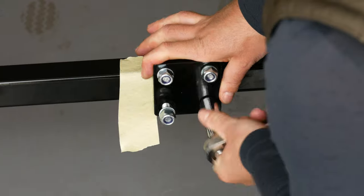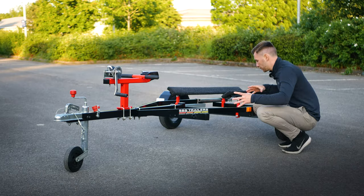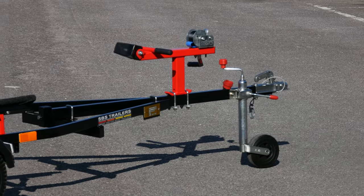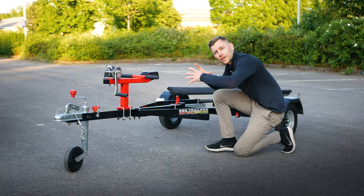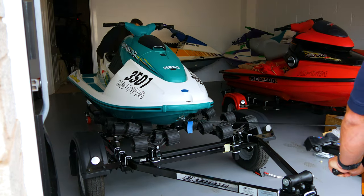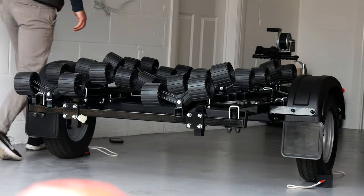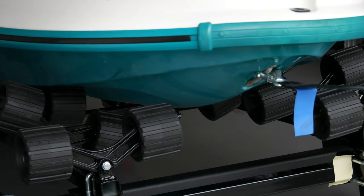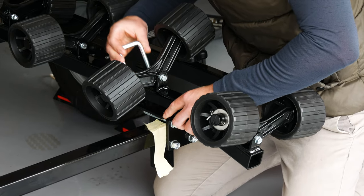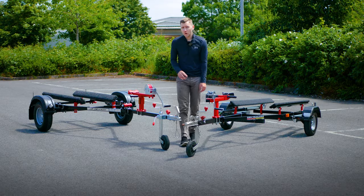The first main difference is Xtreme use a fully modular design which allows you to adjust pretty much anything on this trailer, whereas SBS use a more traditional welded design meaning more pieces are actually fixed in place and only certain aspects like the draw bar and the winch post can be adjusted. A great example of Xtreme's modularity is that I'm actually changing out the bunk assembly for what's called a roller bank assembly, because in certain scenarios different setups suit different hulls. If you can have one trailer that does multiple things and the parts are interchangeable, that's a huge deal. In my experience, the Xtreme offers way more versatility in how you can set it up for different hull sizes.